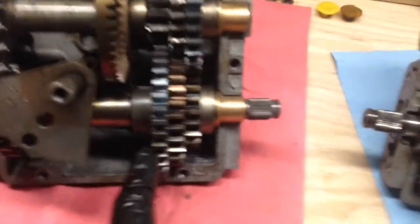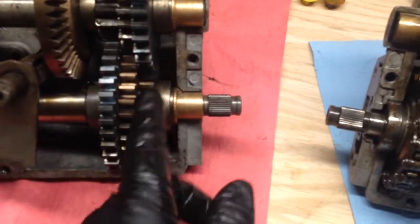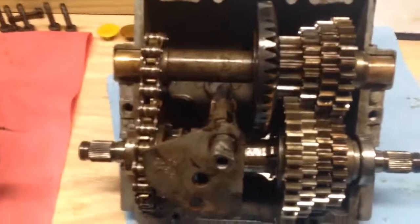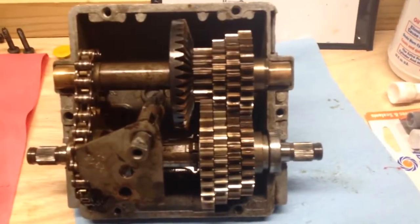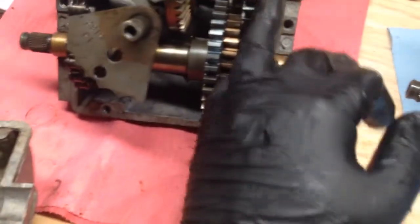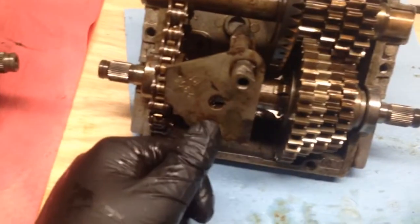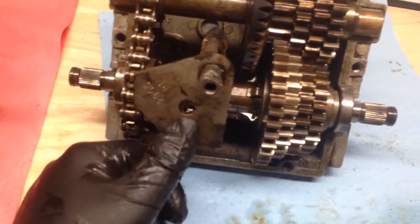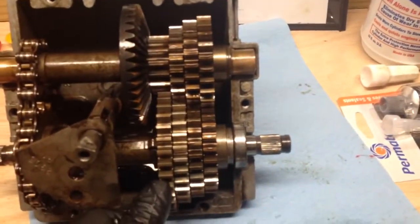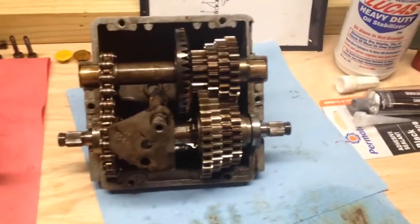This one does have one much smaller gear — this would be the high speed gear on the three speed, and it's just one size smaller than the high speed gear on the four speed. Since I'm going to use this transmission in a four wheel drive application, I actually want lower gears and don't care about the high speed gear ratio. I could take this gear set, take these spacers out on the four speed, put those gears in, and make it a five speed, but then I'd also need a five speed shift mechanism, which I don't have. So the four forward gears are good enough for what I'm doing.